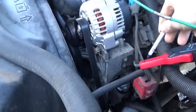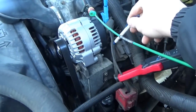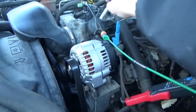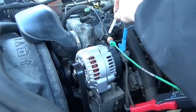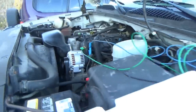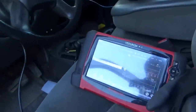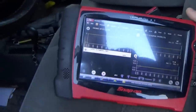Alright everyone, final shot on this Chevy truck — finally got the PicoScope to work. It's a bright sunny day, maybe it likes the sunshine or the warmth, I don't know, it's working. We're doing three channels: channel 1 is the voltage blue trace, channel 2 is the amperage coming out of the alternator, and channel 4 is the command percent duty cycle that the alternator reports back to the computer. We also have the scanner reporting signal ignition voltage and engine speed. Let's jump in.